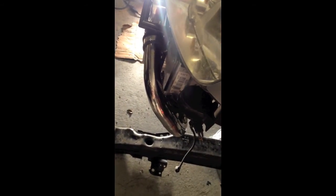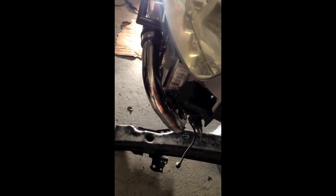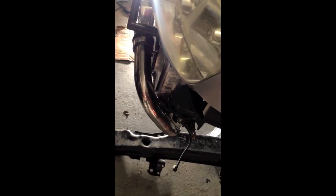We've got some Diesel Geek Panzer plate side covers that we're going to put on here, and then we'll have to do a little bit of trimming of those to make them fit. But this does fit very well with the Evolution skid plate. The skid plate sits right underneath that front stainless bar, or stainless tubing, for the intercooler kit. We did notice that you have to put about 2 washers in between the plate and the brackets on the front in order to push that down just a little, but it fits very well.